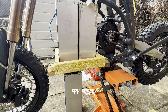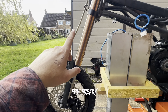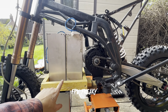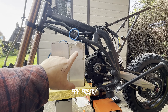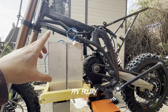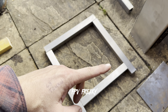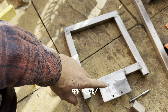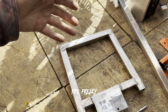I've just mocked up the battery position, taking the mud guard off. This is just made temporarily so I can get an idea of how big it's going to be and where the battery is going to sit. Now I've made my cage out of stainless, I'm going to weld this up. I've made a plate so I can bolt it to the subframe.